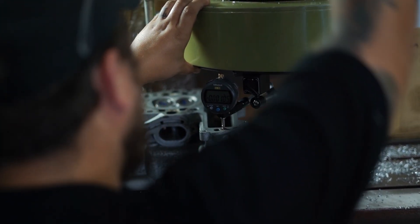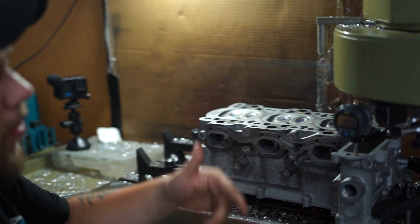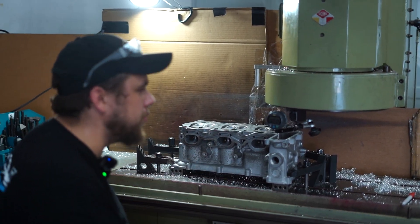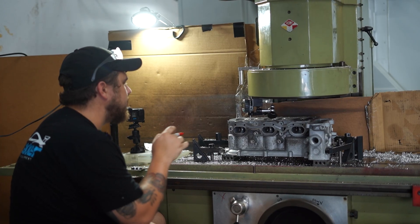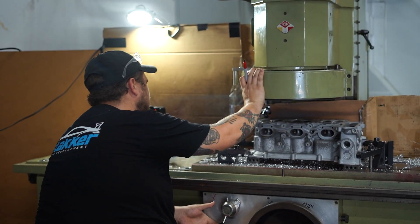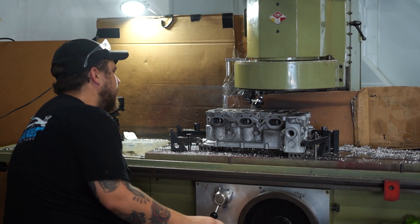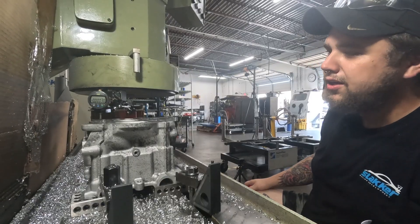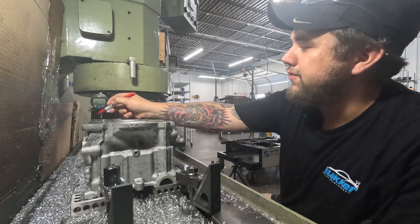Now we're going to check what putting the shims in has done. By putting a three thou shim here, our zero point is now about a thou under, so it did swing that down a little bit. That's the main reason we check after making adjustments — to make sure we got the results we were looking for. After re-zeroing and sweeping, on this head the really bad corrosion spots are in between the water jacket ports. Those are the low spots. Overall, minus the corrosive spots, I'm only seeing about one to two thou of deviation. Some of it low, some high — besides the corrosion, it looks pretty typical, but that corrosion is going to make us skim a lot more off than normal.